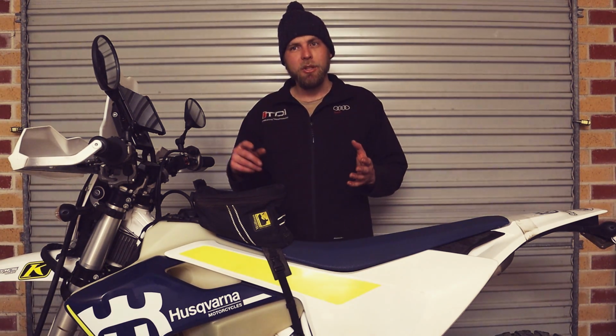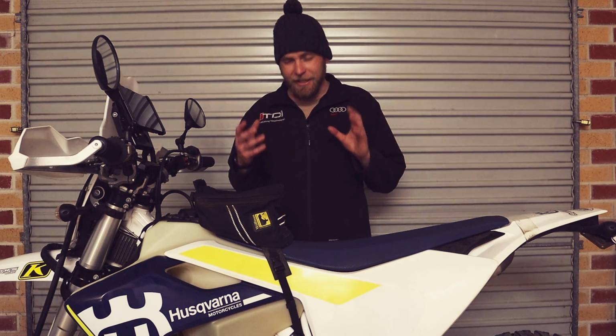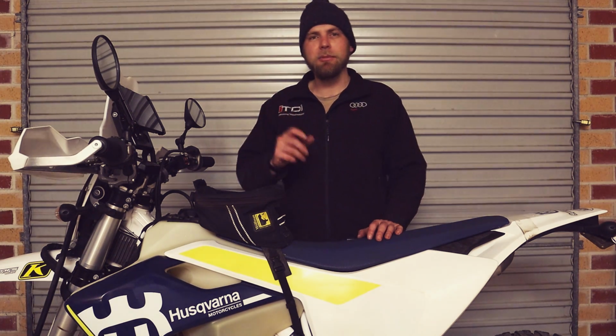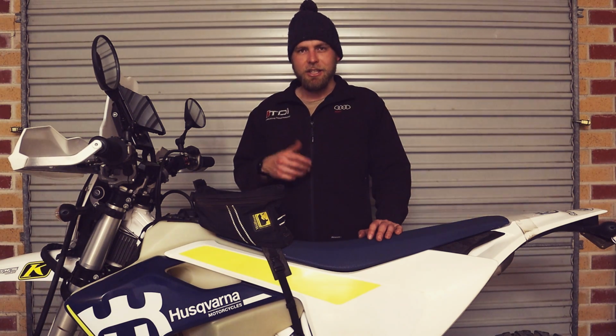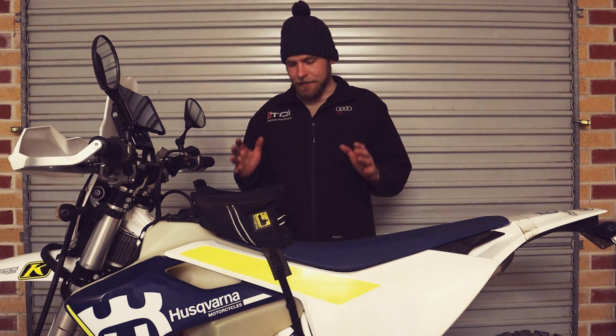Second tip, when you're putting those last 2 bolts in, the other 4 bolts that are in there already, leave them super loose. It gives you a lot of play in the bash plate to locate those 2 holes for the last 2 original bolts. And thirdly, I'd probably use Loctite. I do it on all my bikes, on all their bash plates. I put a little bit of Loctite on the bolts before you tighten them up, just for a little bit more added security. Other than that, I think it was about 200 Australian dollars shipped.